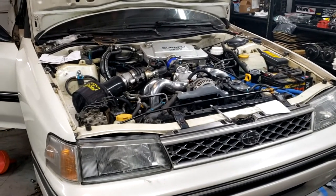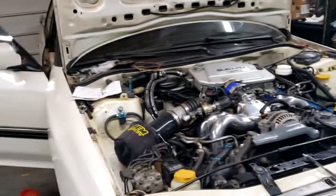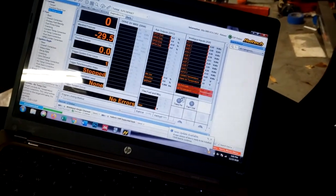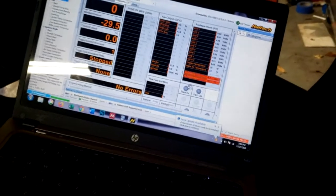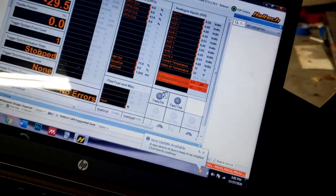What's up guys? Today we're going to attempt to start the Legacy. I've been playing with some of the issues I've been having with the Haltech. The problem I was having with the intake air temperature sensor — I have it reading good now, it's at 51 degrees. Only two of the AVI inputs have a 5-volt switch where you can enable a resistor that sets it at 5 volts. I had it on one that didn't, so I swapped it from AVI 1 to AVI 4 and enabled the 5 volts. Now I have a good signal.